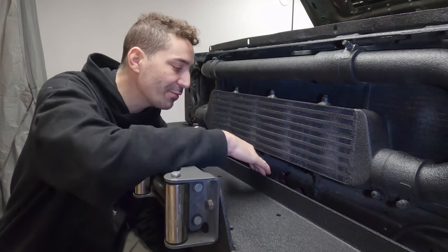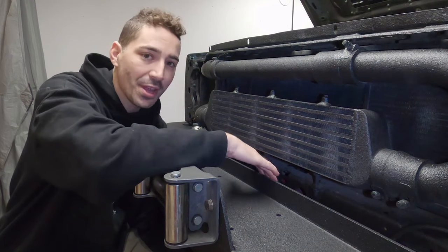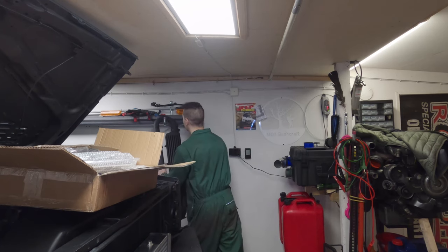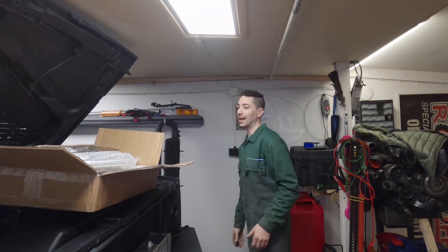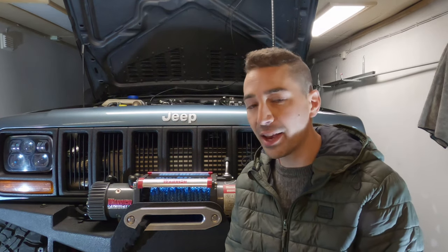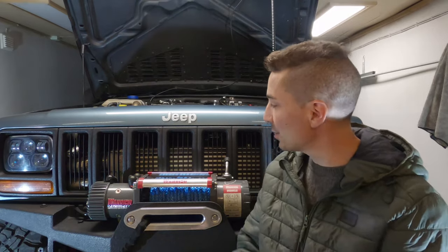I've had one that has an exit on both sides, but it ended up having very long charge pipes, and it gave me some nasty turbo lag that I wasn't really that keen on. Now I've gone for a same side intercooler of a pretty decent brand.